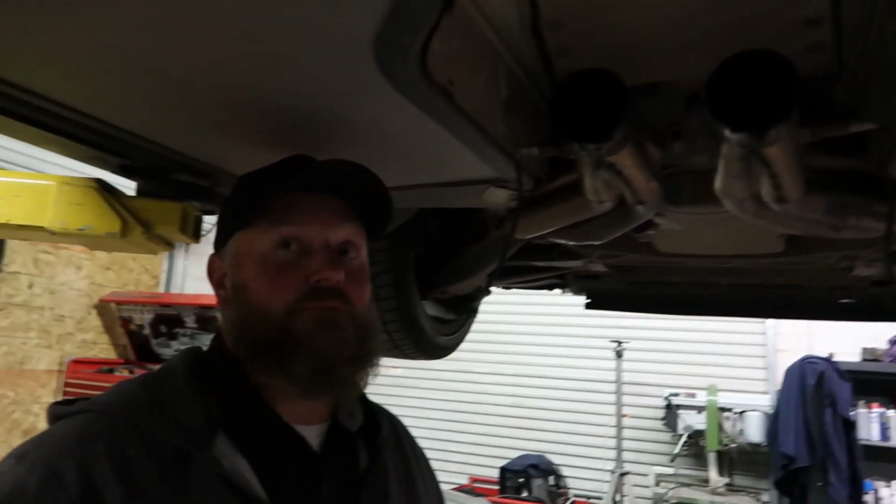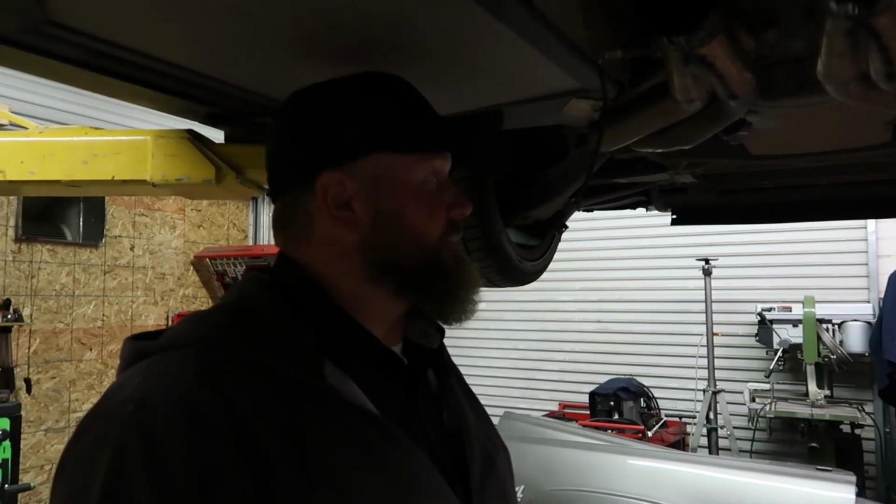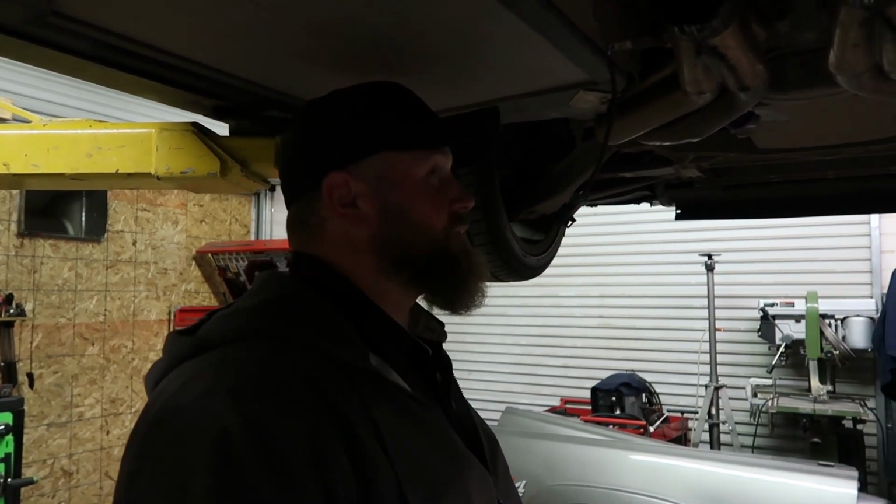And then separate it. Do the torque converter. And then pull the cam and stuff out of the motor, do the work on the engine, and put it all back together. So outside of the wiring harness, the brakes, and disconnecting the cradles from the car itself, it's just the quickest and easiest way to do it. So that's what I'm getting started on.